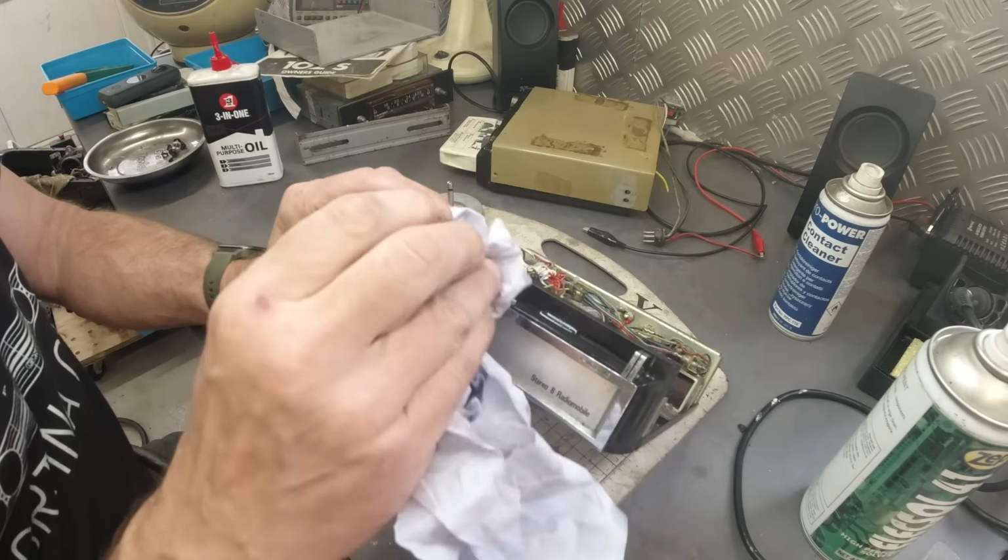I mean, you've nothing to lose. That one broke. That one's okay. You can glue it back together. You've got no choice. You have to do that. So that's the tape. And the first thing, as we've discussed, and so has everybody else in the 8-track world, is your foam pad comes off, out for starters. Lightly dust out. While you dust out, you mustn't let the tape unspool, so you've got to hold that.